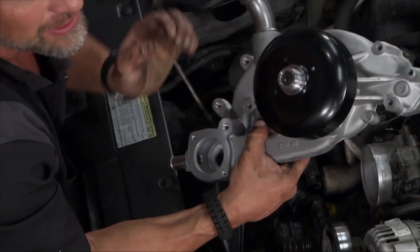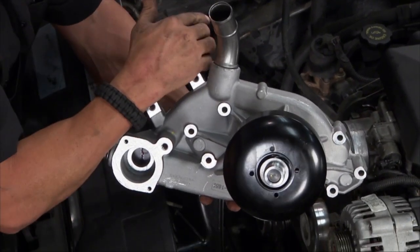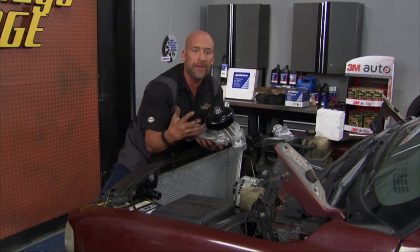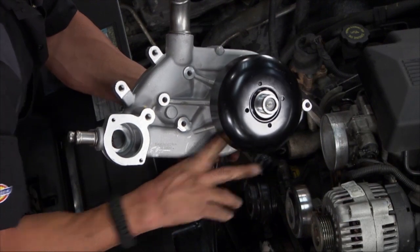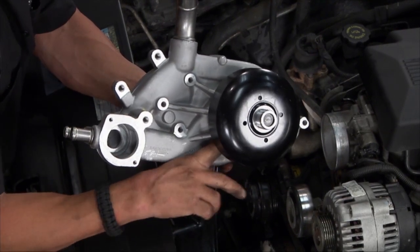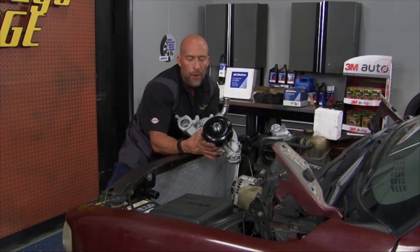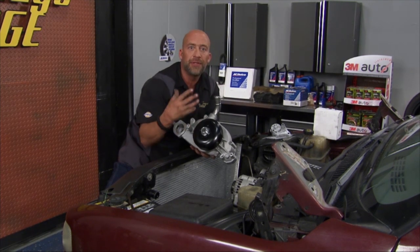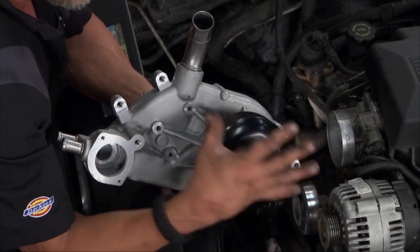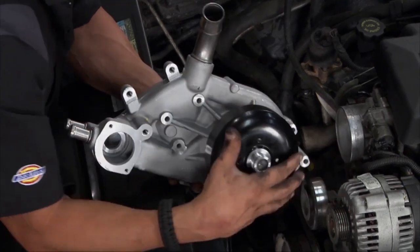There's some cheap imitations out there, but with AC Delco, you know you're getting exactly what GM puts on their cars. They are GM when it comes to things like water pumps. Let me show you some things that they do that other guys don't. All right, so you know you got this bearing sitting in here, right? The weep hole right here in the middle. So when that bearing fails, you're gonna see some fluid weep out of that. But they have a ceramic seal, really impressive stuff, where some of those other water pumps won't have that quality part in there. Behind that bearing is the impeller, okay? So you know when you choose AC Delco parts that you're getting true GM components and things that are gonna meet all those OE standards and last another 300,000 miles.